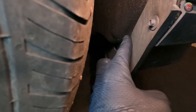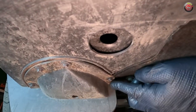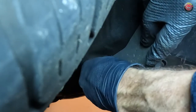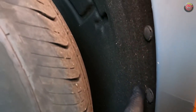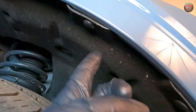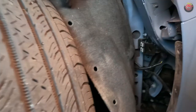The plastic wheel spats at either side are next, and each have three 7mm hex screws at the rear that must be removed, along with four at the bottom of the front. Once the screws are removed, there's a single plastic pop clip in the wheel well that attaches it to the fender liner that also must be removed. Next, you need to take out at least six of the body pop clips on each side of the felt front fender well liner, which allows enough of it to be pulled back to get your hands up behind the bumper. This is where using that body clip removal tool really makes it a breeze — just watch the painted surfaces. Once these are all out, you're free to pull back the front wheel well liner.